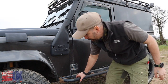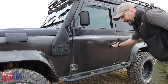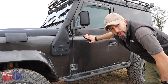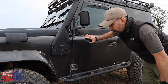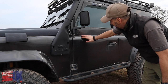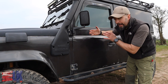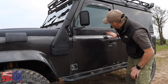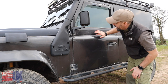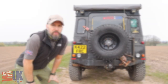The Shire Fabs rock slider and tree slider on this side also need sanding back and repainting. The doors all open and close perfectly — no bouncing, no missing the catch — but the doors will need replacing or repairing soon. One of the common problems on Land Rovers is when it's raining, the rain runs down inside the door and rots out the bottom, which has definitely started happening here. Also, where the steel window mechanism touches the aluminium door, it causes the aluminium to oxidize — the paint has started bubbling and flaking back to bare aluminium, so that's something the new owner will need to address.